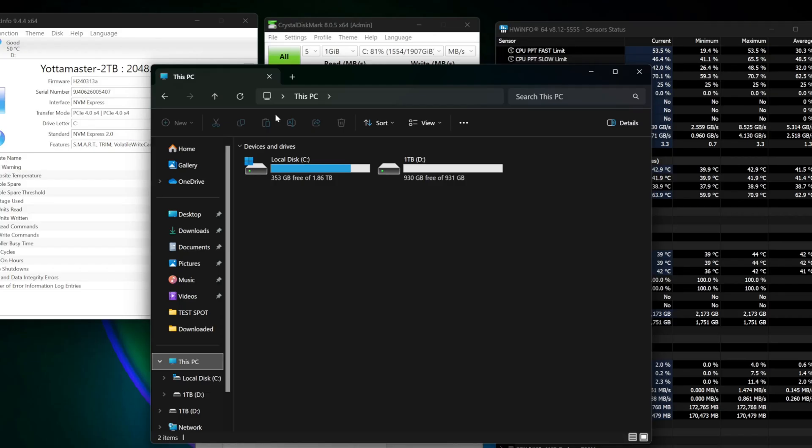So we filled up the drive. It did take a while because it did run out of cache eventually — it's not going to be one of those drives where you can just write and write and write indefinitely, which is fine. I don't think that's really what it's designed for — doing 500 gigabyte transfers at a time. It seems to be fine for probably a couple hundred to 300 gigabytes in a go, and then it starts to slow down. So don't use it to move gigantic files all at once.